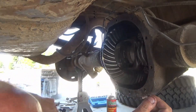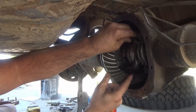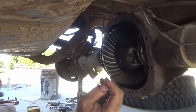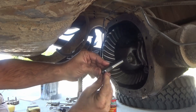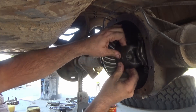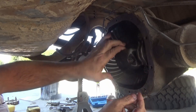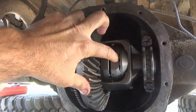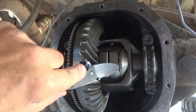The next step after everything is meshed is to go in with a screwdriver and push the axles outward, making sure those little disc rings are pushed in all the way. Then I rotate the couplings around so everything lines up with the center pin hole. Then I take the new center pin that comes with the kit and slide it in place — you may have to move things around a little bit just to get everything to slide into place. Once it's in, you're ready to put the center pin retaining bolt in place. That bolt has Loctite on it, so as long as you can see a little bit of red on the threads you're all set to tighten it up.